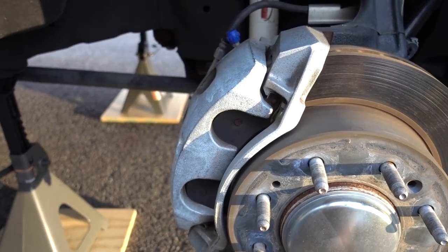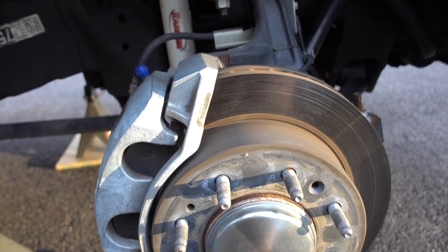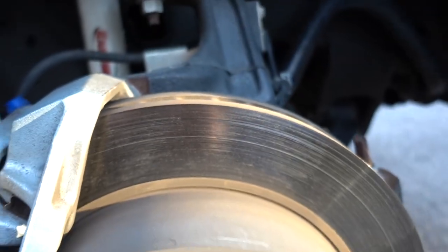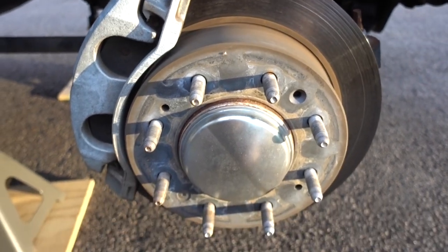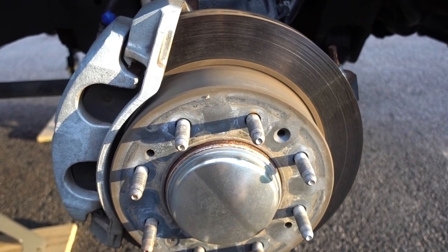I'm not a big fan of the silver color. I was also having an issue with a little bit of steering wheel wobble when the brakes get hot. These front rotors have some pretty good grooves in them, so it really wasn't worth it to try and take it up to the dealership and get them to turn the rotors. So I just got new rotors - better rotors.